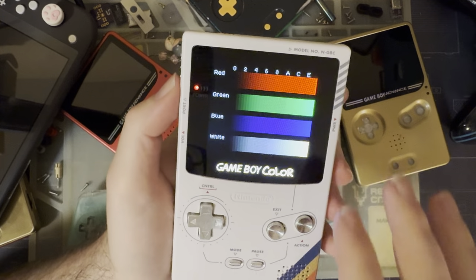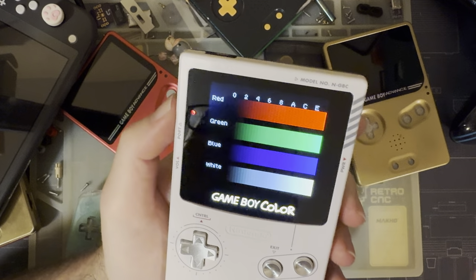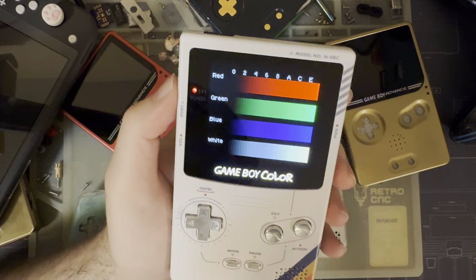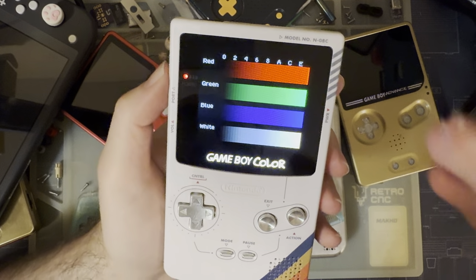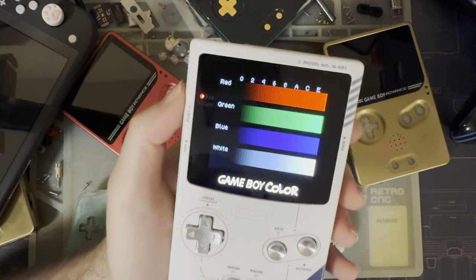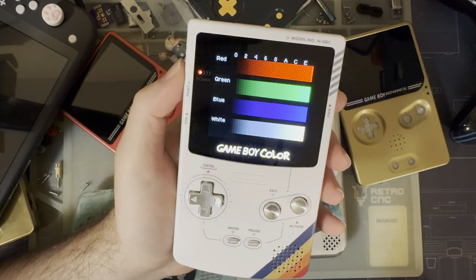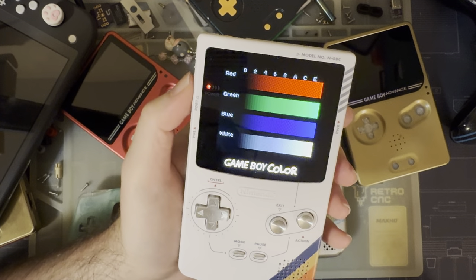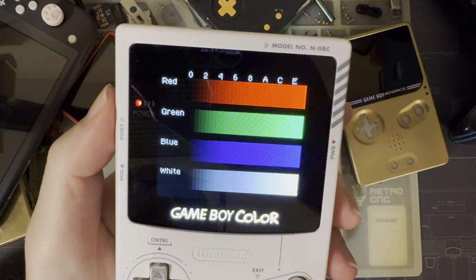A lot of elements in a lot of games don't really move around as you're playing them. So if you play nothing but Pokemon, chances are after a few hundred hours you'll have your character burned into the center of your screen — maybe you will, maybe you won't. During actual gameplay the screen is constantly changing from one scene to the next; it's not a static image, so it's not as terrible for your screen. This is absolute worst-case scenario: brightness as high as it goes, which puts the most wear and tear on an OLED screen, plus a static image just sitting there.